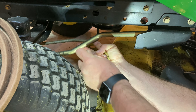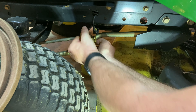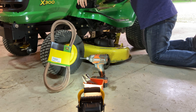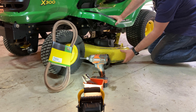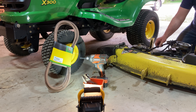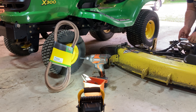The first thing we want to do is remove the deck. Start that process by removing these pins. I pulled the pin out — this is going to feed through the back, and a little bit of upward pressure on the deck helps. Make sure we keep these together. Same process on the other side. Now we want to just slide the deck forward a little bit. Our goal is to get this front bracket off of the deck. You can also roll the tractor backwards, but we are in park, so we'll just scoot forward. What I like to do is use a short bungee cord to hold this up, stick it on the frame, wrap it around a couple of times, and that'll hold it up out of our way.